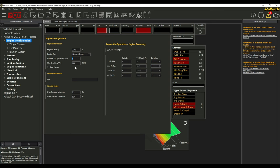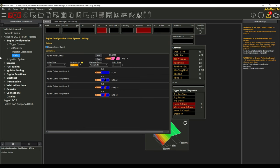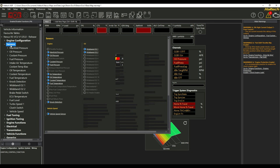The program only knows you're running a four-cylinder engine, so every single part of the engine and electrical system you need to input and tell the computer what to do. This is a 2.2-liter four-stroke four-cylinder — you enter your firing order and it inputs that into other parts of the calibration. It'll automatically help select your fuel system wiring, so here we have our four injector wires along with our ignition system — a 25-amp power output for the coil packs and four ignition outputs.